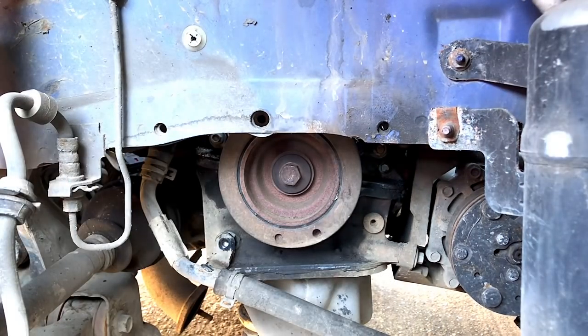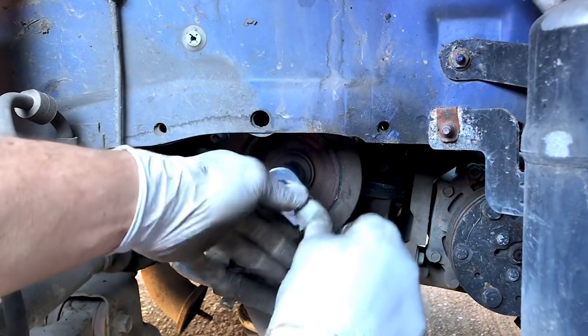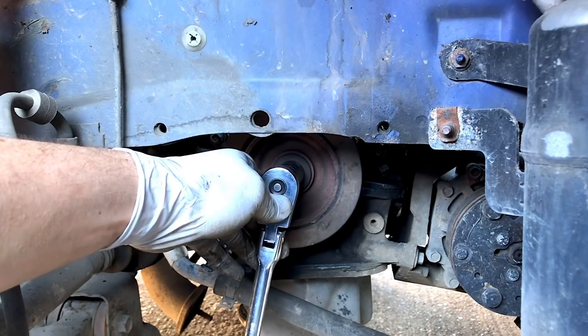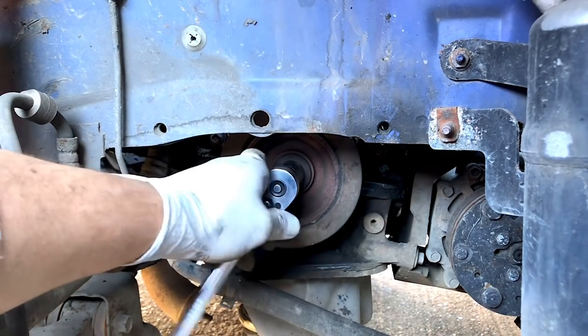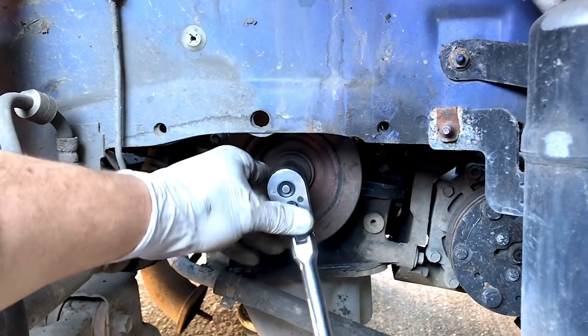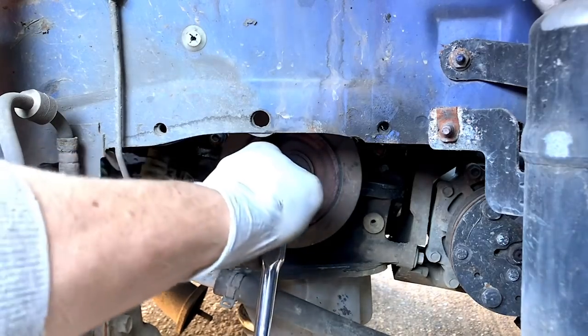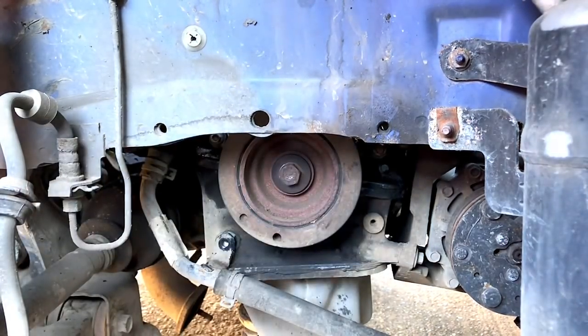With the locking pin on the crankshaft side, you literally just turn the crank clockwise now till it comes up against the pin. You can see it's turning and it's jammed against it now. Don't go onto it too hard because you will bend the pin. That's where you start - that's timed now - but there is another timing mark I can show you.